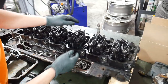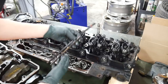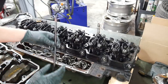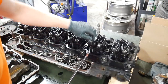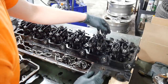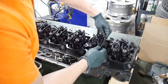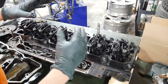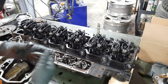Now you've got the valve train. The interesting thing — here is the push rod out of this engine compared to an LS push rod. They're much longer on a Cummins, and on the LS it's got a ball end on both sides, but on this the cup is on the Cummins push rod. This is how you adjust depth when you set your valve lash — it's got a lock nut and these are threaded into the rocker arm, which is kind of archaic, but man, it works and these things last forever. Also, each rocker arm services two valves, which is pretty awesome. They have this little lash cap that likes to fall off. But this is a pretty robust design — these things are meant to be serviced and meant to last as long as the truck, or longer.